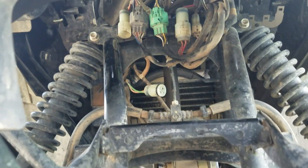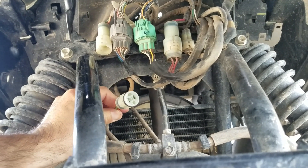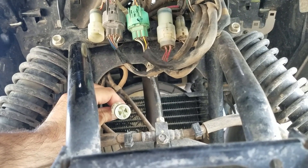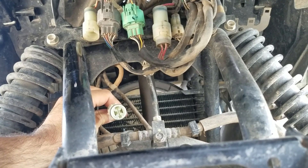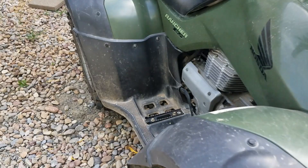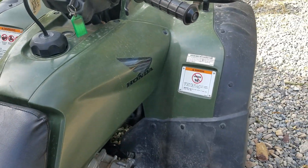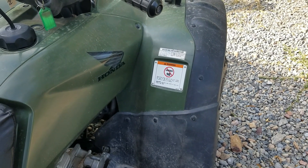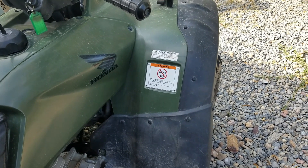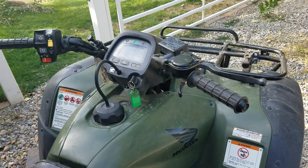This is the skid plate. If you come up above the skid plate, I've already unplugged it — it's this white piece right here, and it plugs right in there. I'm going to start measuring the resistance between these two wires. When you turn on the engine, the ECU does a quick check and looks at the resistance on the electric shift motor. If it's in a certain range, it's okay to start shifting normally. If not, it's going to kick out that code and you won't be able to shift gears at all.